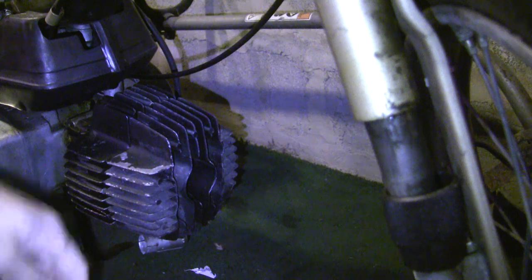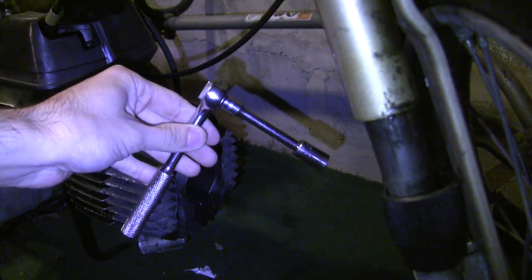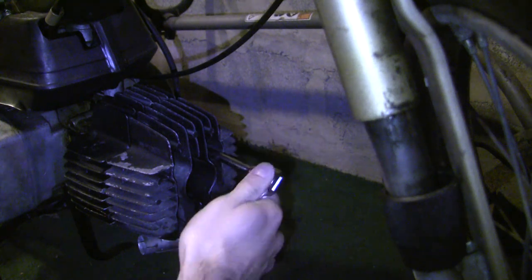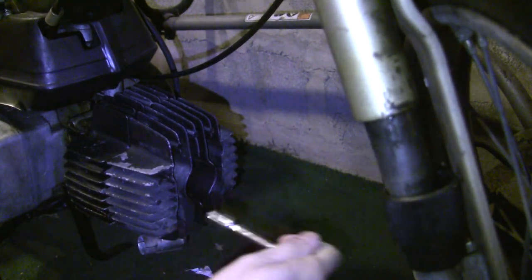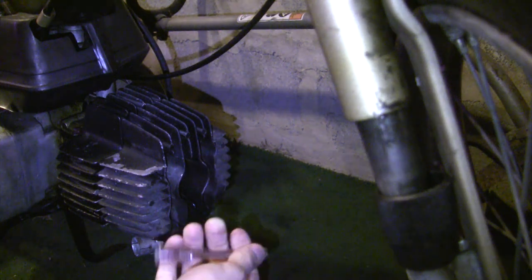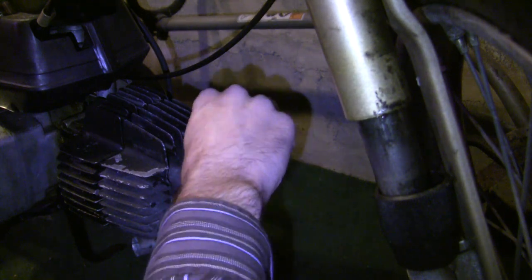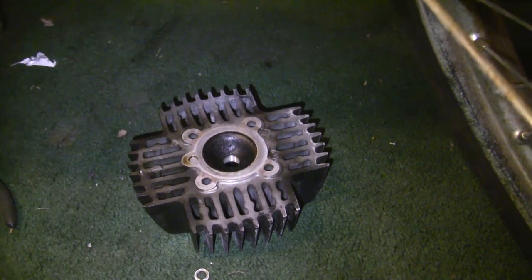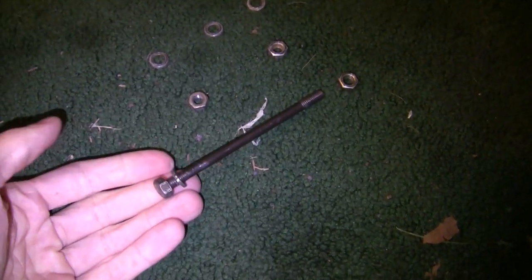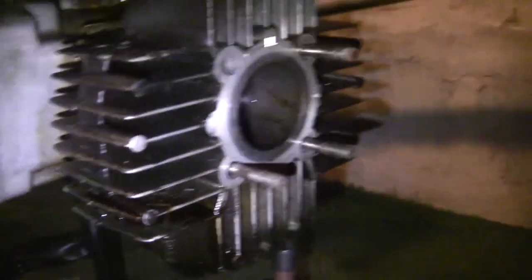Let's go ahead and take a look at that piston. You've got four head nuts right here — one, two, three, and four. It really helps if you get a little midget socket set with an extension; these are 10mm nuts. This particular head is not very friendly to getting the nuts out easily, so you can take the end of the socket and kind of rotate it — after the nut's all the way loose, the nut actually ends up in the bottom of the socket. The head came off; note the head gasket's still on there. Make sure you get all four of your nuts and all four of your washers. One of the studs came along with the ride — that's okay, we can install that back in, the threads are just dirty.